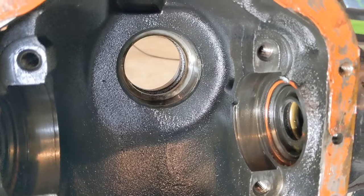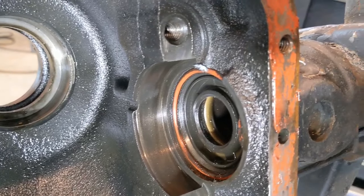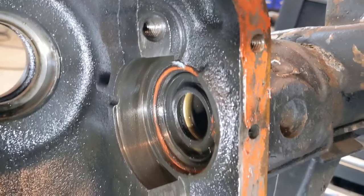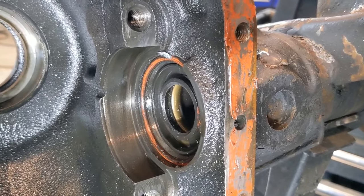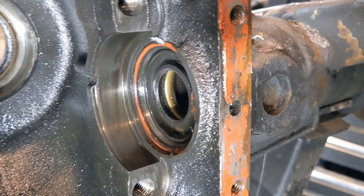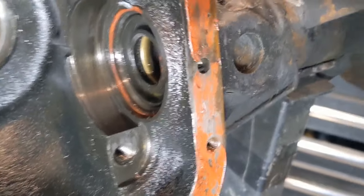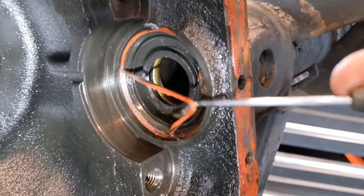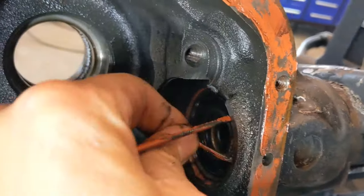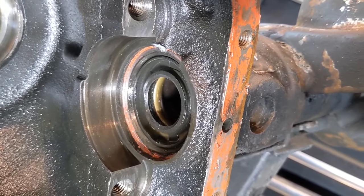Now that we have both races out, the axle is almost ready. The only thing left is to remove the inner seals. These seals have a lot of miles on them — they look good, but since you're in here, replace them. If you see an orange round gasket-looking thing, that is not a gasket at all. That's sealant used when they press in the tubes from the side of the housing — it just comes out the other side. You can take a pick and pull it out — no harm whatsoever. It's not a seal, just leftover sealant. Now let's punch those inner seals out — easiest way is to take a pipe, put it in from the exterior through the seal, and tap from the outside.